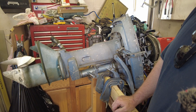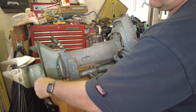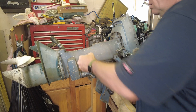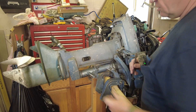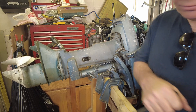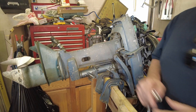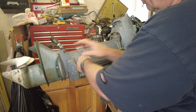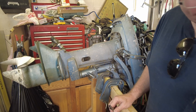The first step to getting the lower unit off this motor is disconnecting the shifter shift rod. It goes down through into the lower unit and engages with the shift dog. Behind this little cover there should be a coupler that joins the shaft that's part of the lower unit to the shaft that's part of the upper part. It's a little grungy, but a flat blade screwdriver doesn't want to do it — looks to be a 7/16 socket, or maybe 3/8.